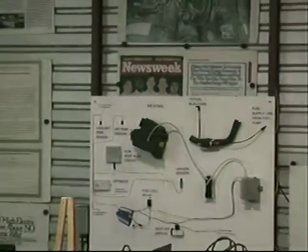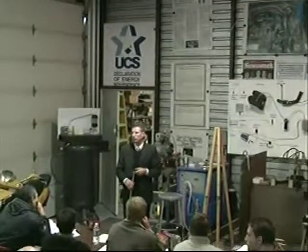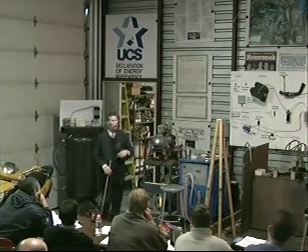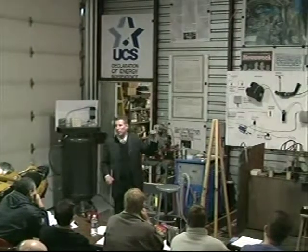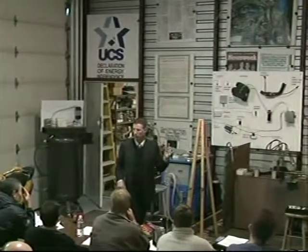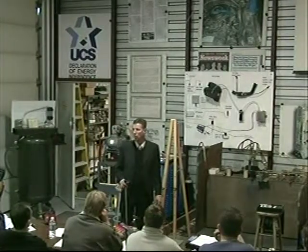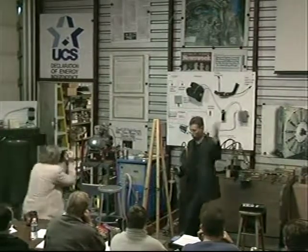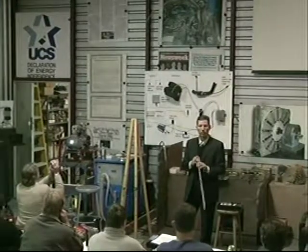Any questions on how that's rigged up? Did you say that it goes on the engine side of that filter or the before the ambient side? You want the paper element to act as a final barrier for any of the caustic solution that may have got that far. Hopefully it won't, but if it does, at least that paper filter element will keep it from getting sucked into our aluminum component engines. Yes, sir.